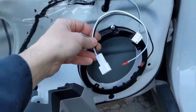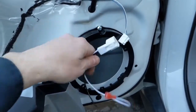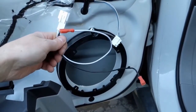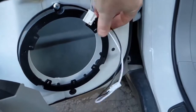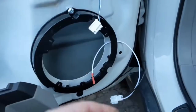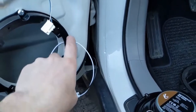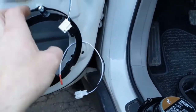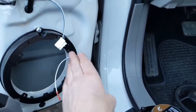I don't have it tight yet because I'm using a harness adapter — it just makes installation so much easier. These are on Amazon or anywhere online. It plugs into the factory harness and gives you two ends for the speaker. Before you tighten the plate down, slide the wiring back behind the plate, because the speaker connectors will be recessed in there, so you have to route the wire behind the plate. It gives you enough space that tightening it down won't squish the wire.